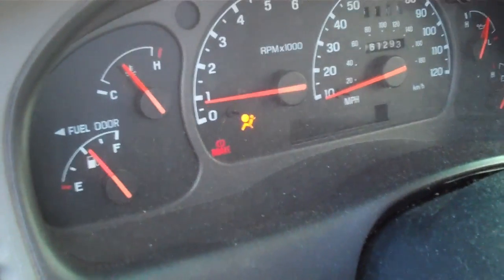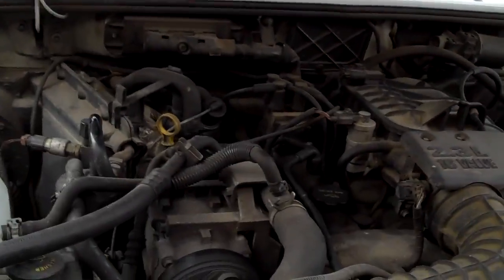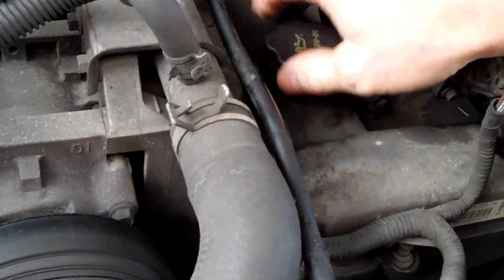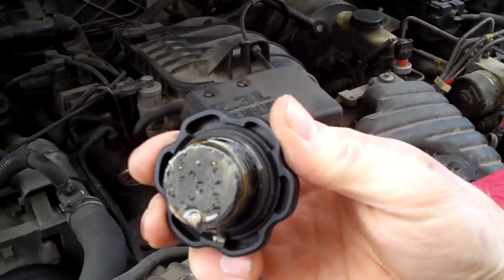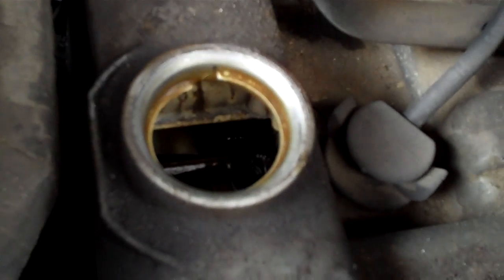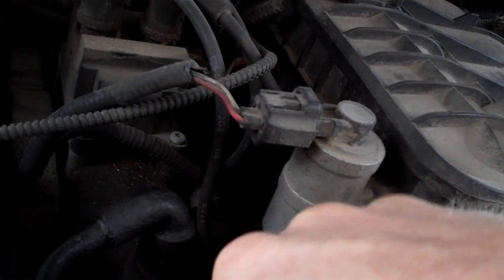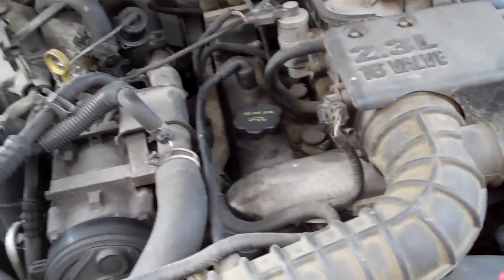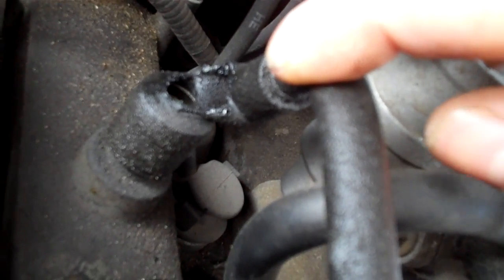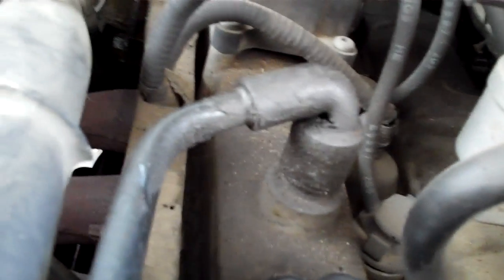You want to watch the temperature and make sure you don't overheat it while you're doing this. I'm going to say this is not a head gasket failure. On my other video about head gasket failure, everybody mentions that if you pull off your oil cap and you've got all kinds of chocolate milk and water swirls, that's a concern. This one has just a very little — not very much at all. Moisture in the air that gets in through your PCV system can cause that. That's not enough to warrant replacing the head gasket. Look at this PCV right here — you can see how it's wide open. Water vapor from the air is clearly getting sucked into that. So that's where your water vapor is coming from. This is not a head gasket failure.